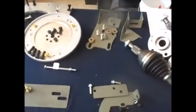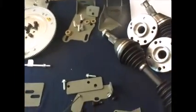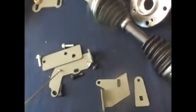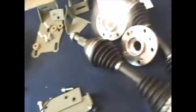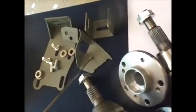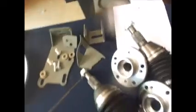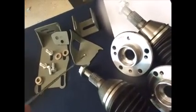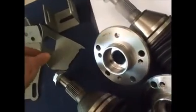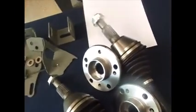All the parts you need to build the drivetrain are here. We have a side transmission mount, a rear transmission mount I call the launch mount — it's right in the middle in the back of the vehicle — and the inner transmission mount. Look how heavy duty these parts are, all 3/16 steel. These are two weld plates: a mount plate for the rear launch mount and a weld plate for the one notch you have to cut in the cross member of the car. That's all. This is contoured to fit — once it fits you know you've properly installed it and you weld that plate in.